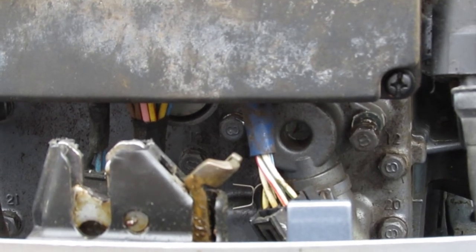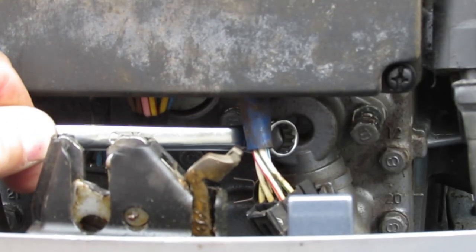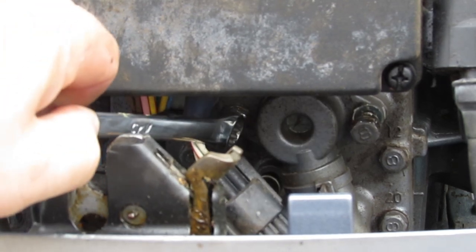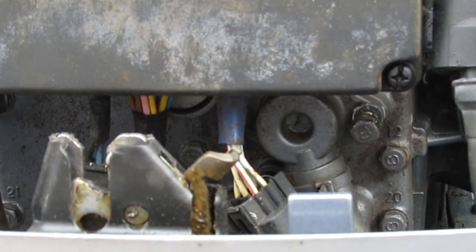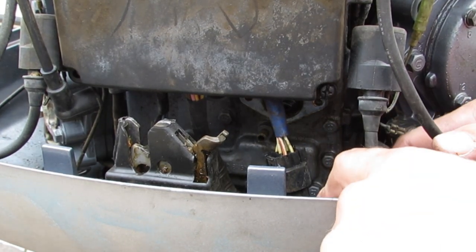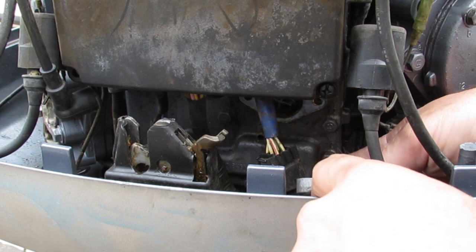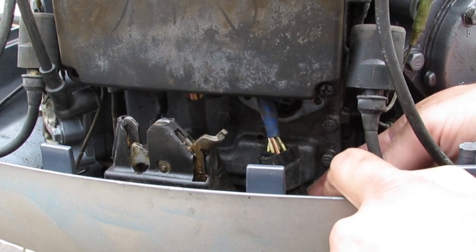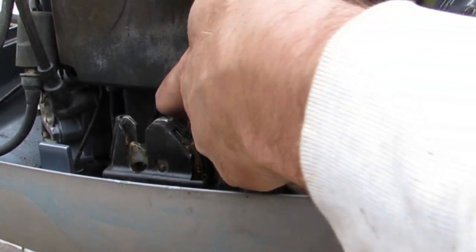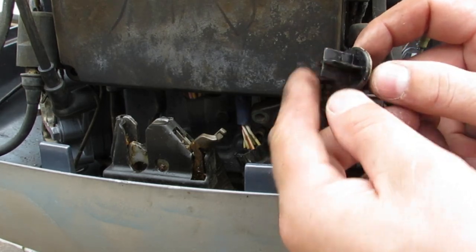There is a little poppet valve down here. It's this guy. I don't know if you can see that. This guy right there. That out of the way. This guy right here. I started to take that off. It's a little tight. I'm gonna try to take that off and see if that tells me anything, because I believe the water comes up through that. So the poppet valve is clear, and there was a little bit of water in there. I don't know how much was supposed to be in there, but it looks like it was wet anyways. And there's a little star-shaped portion of this. Let's see if I can get it out. So that looks freaking brand new to me.